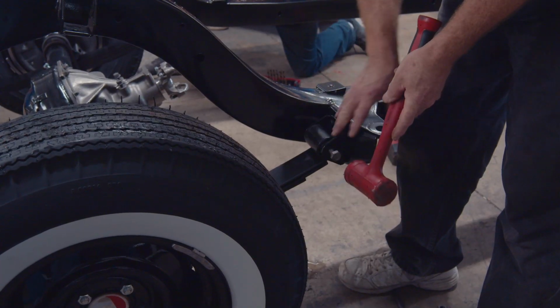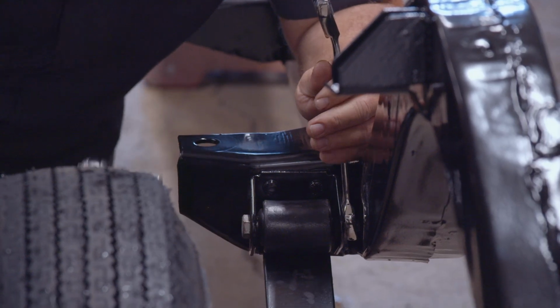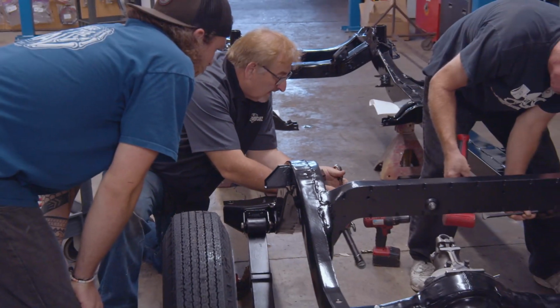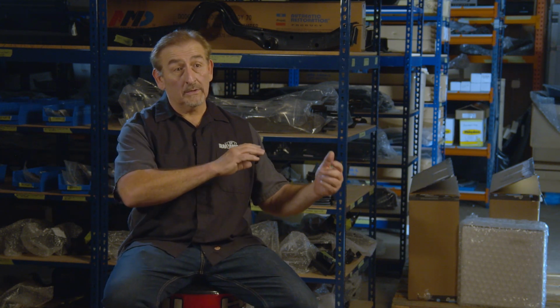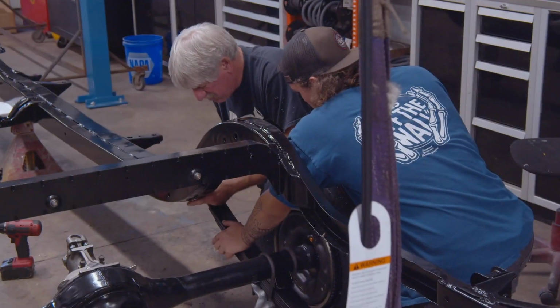So the nice thing about Christine is it uses a leaf spring rear suspension, torsion bar front suspension, just like the cars we work on today. I was able to use a Mopar rear shackle, brand new ones that we stock that we put on the muscle cars. I ordered a pair of replica, original, duplicate leaf springs, and then the original hangers, all we had to do was take them off, media blast them, paint them, and get ready to put it back on. So our bushings and our inserts and things like that, we were able to use the stuff off of today's car on that car. So there's some interchangeability there, which I think is kind of cool. Another 10 years prior to the stuff we're working on, they were using the same stuff.